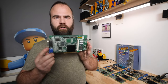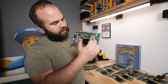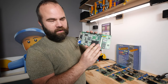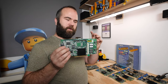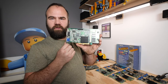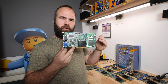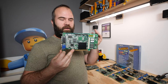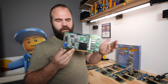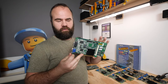Now an awesome card — but there are still better options. This is a Matrox G200 with 8 megabytes of memory, plus a secondary 8 megabyte memory module, making it 16 megabytes total. This is a really good card with a really good VGA output. Like almost all Matrox video cards, for a workstation build back in the day this was a great card. It's not a high performer, but together with the Voodoo 2 it works really great. This card is good for Pentium 2 233 up to Pentium 2 450, with really good high-resolution VGA performance.